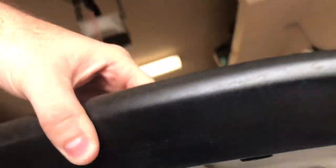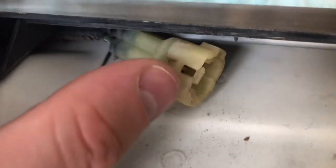You're going to have the wires coming from here that go to the rear brake light. I'm not going to be using a rear brake light so I can remove that. All you have to do is lift this little connector right here — as you can see, a screwdriver and it came right out.